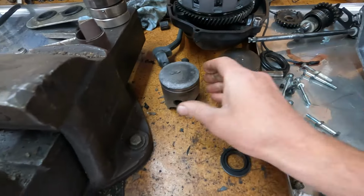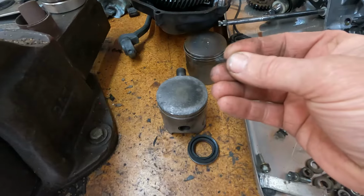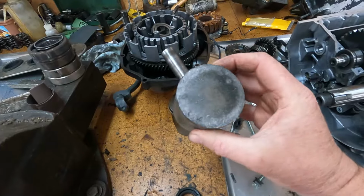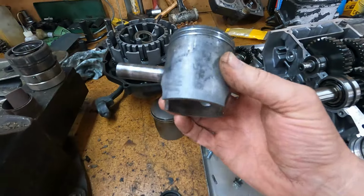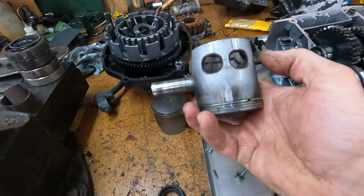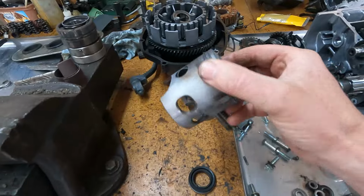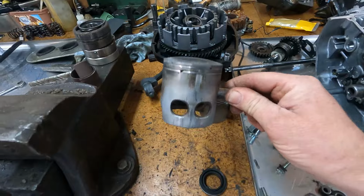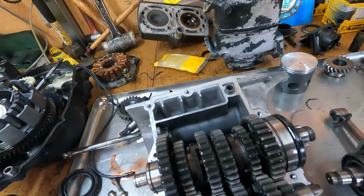Looks normal. This is the other side, and that fell out of the case, so that's a roller, flattened out roller. You can see the pistons just all pummeled on the top there. Rings are welded in, but doesn't have any grooves. There's a couple of little scratches there, but bugger all. It came out unscathed, really. I mean, the piston is buggered, but you would have thought there'd be just grooves up and down that, to lose all the rollers out of the conrod.